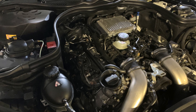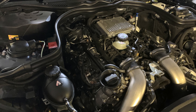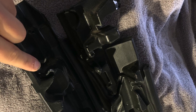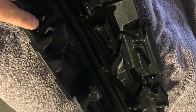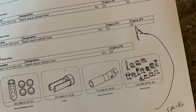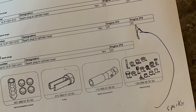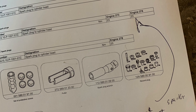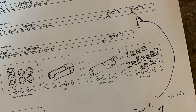It's a 14 millimeter but it's a special 12-point socket — I'll put a link in for that. You're going to need swivel extenders. The places they put the spark plugs are interesting, just like the fuel injectors: it's sort of beneath where you'd imagine, much deeper than you might expect.